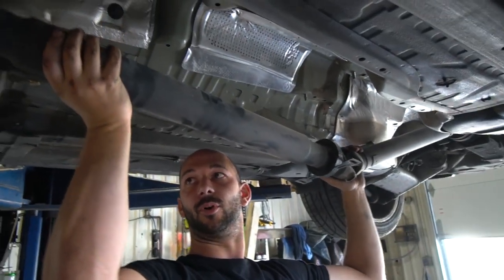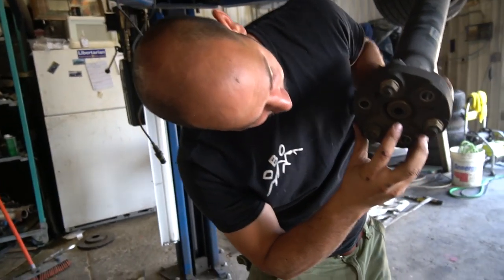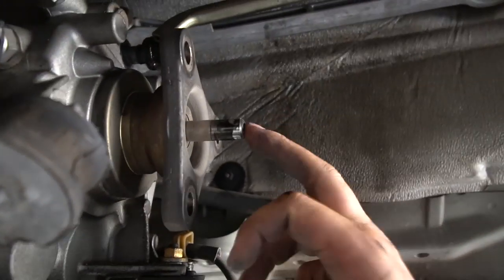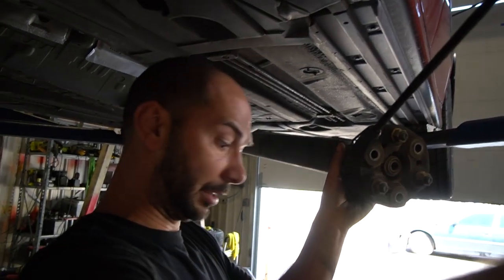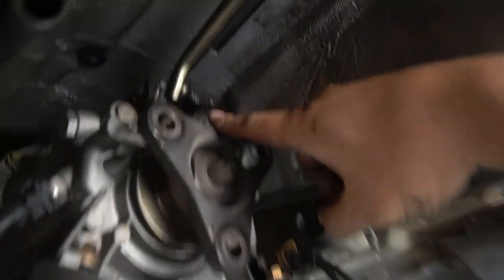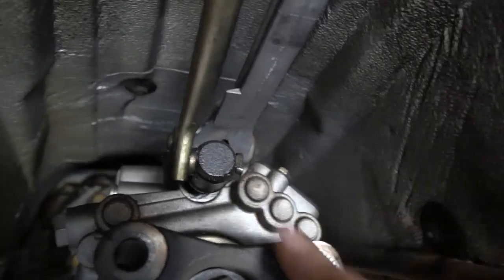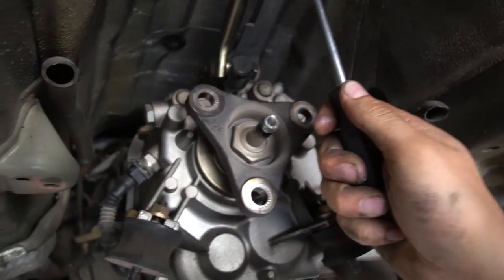Pull down a little and it will pull this part away from the pin on the drive shaft. There's a hole with a slight bearing there, and a post sticking off the back of the transmission that goes into it. Working on a lift is nice for this. The shift selector seal — there's oil there and these almost always leak. They're not too bad to replace and the part is very cheap, so if it's leaking and you're doing this job, I'd recommend replacing it. This is your carrier and this is your selector rod.